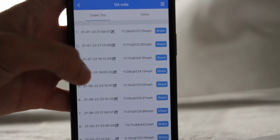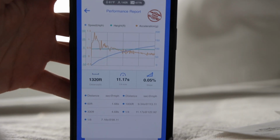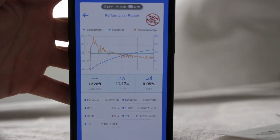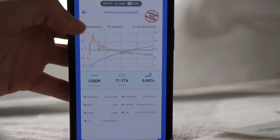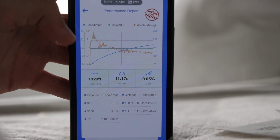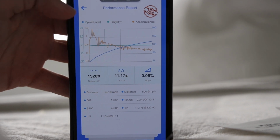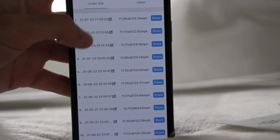The most interesting thing here is if we go and look at the quarter mile runs. The thing to note here is you can see the G's actually ramp in at the beginning of the draggy chart. That's because the car's not building boost on launch control, so it takes a second. Whereas in an RS7 or an S8, you'd be brake torquing, so you're preloading the axle and the suspension. I think that's what snaps them. Although, I don't know, down the road, when I have bigger turbos or whatever, it may do me in.